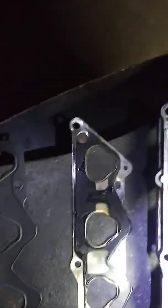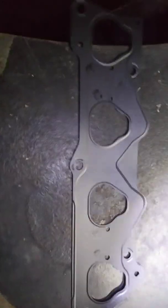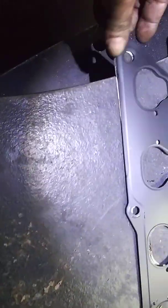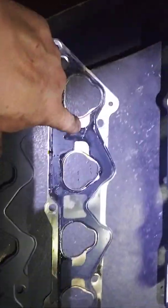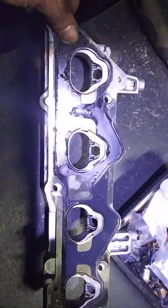I didn't look at the old one. The old one has these two holes right here, and these two holes. So if you line it up here — if you put this one on, you're actually covering up these EGR ports. And in this gasket, you're letting them breathe.